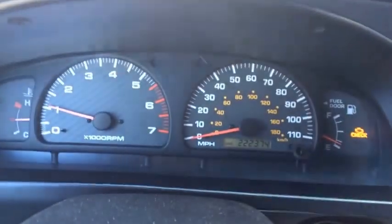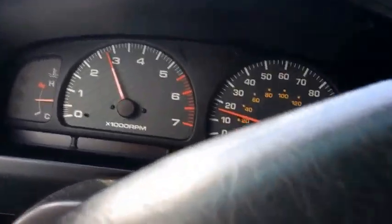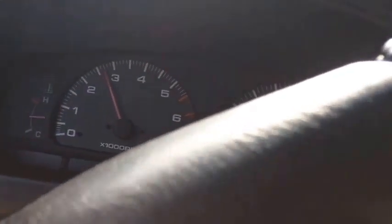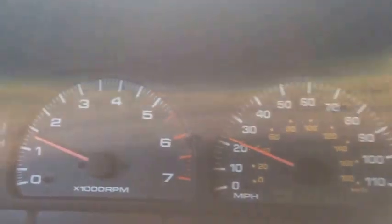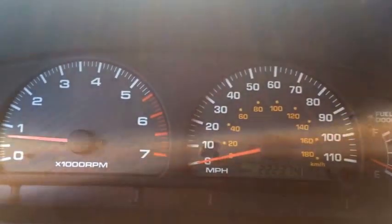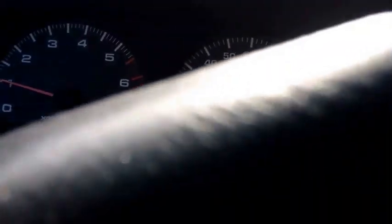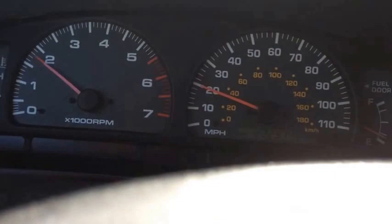The next thing is to test the brakes. Take the car up to at least 30 miles an hour and slam on the brakes. I took it up to just about 30 and hit the brakes — and it stops solidly, really solidly. Keep listening to sounds on the car, just anything, especially when you're shifting.